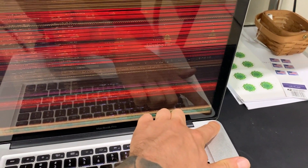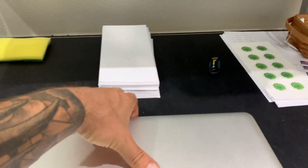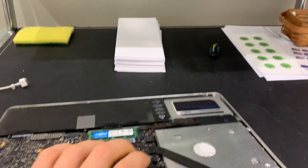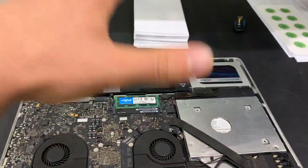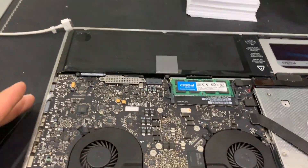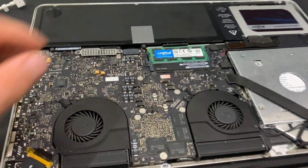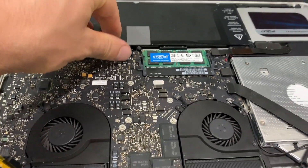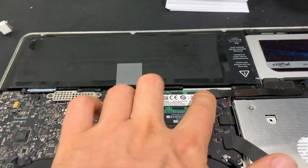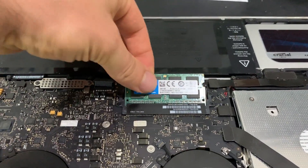I'm going to power it down and we'll get to work. Let's start the surgery process — it's hard-powered off, not the way you'd want to shut it down, but the way we're going to have to. Flip over the computer and take the cover off — there's a series of screws, you can't miss them. There are tons of videos on how to do this, so I'll whip right through it. Definitely going to want to disconnect the battery first. I'm not some sort of computer nerd who does this every day — I've just done it so many times it's become, unfortunately, fairly straightforward.